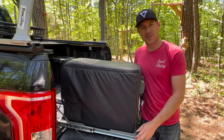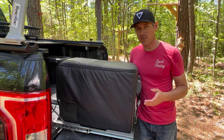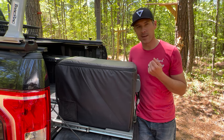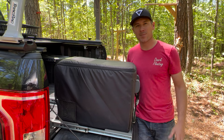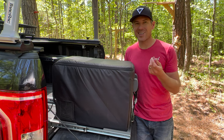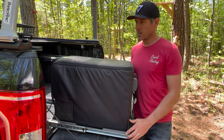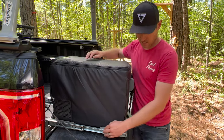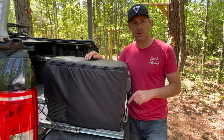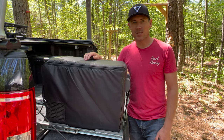We've also added the IceCo fridge slide, which is very handy for long-term use, allowing anyone to easily gain access. Highly recommend it. We didn't have the slide for the first month of travel, and after a while pulling it in and out we noticed the DC cord was raveling up and became damaged. We reached out to IceCo and they sent us a replacement cord no questions asked — actually an improved design that stays better connected in the DC slots. We coiled it up and zip-tied it to the slide so it won't drag and get damaged. If you're going to use this longer than a week I would highly recommend including a slide, especially for full-time use, to protect your equipment and allow ease of access.